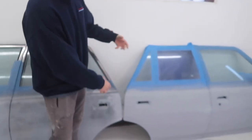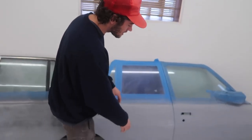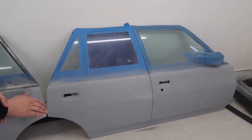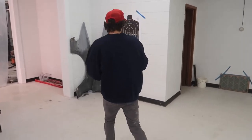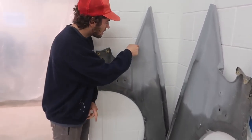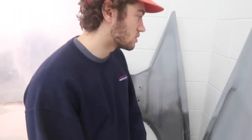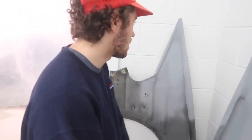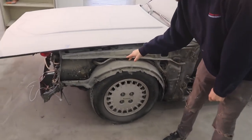What is up guys, we got plenty to do today. First thing is we want to try and prep the back side of the doors and then the jams on the car, and that way we're going to be able to rehang these and finally figure out our body line situation. We're going to try and mute the body line as much as possible — having such a crisp line initially isn't that bad, it gives us a good basis to then take that body line down and make it look as round as possible. While we're doing that we're going to try and finish off these front fenders, get some glazing putty and fill up a lot of these smaller pinholes, really finish those off and get the inside painted black, and then we'll be able to rehang these after we get those doors on.